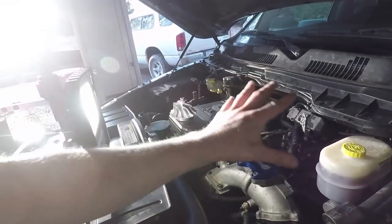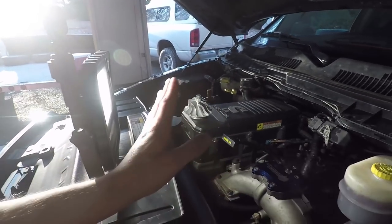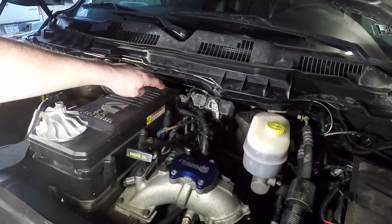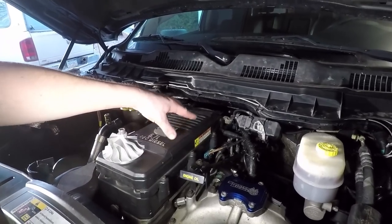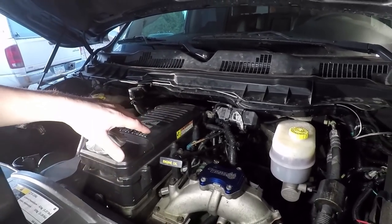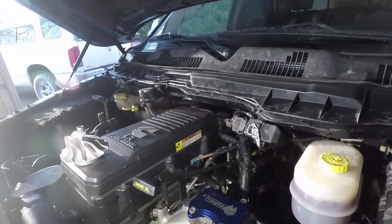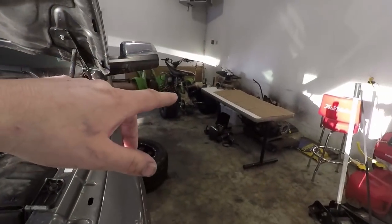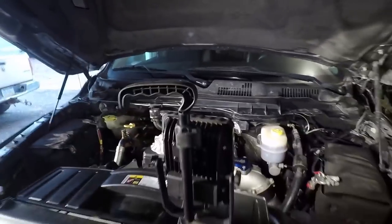We got the oil drain disconnected, the oil feed, the coolant pipe, got the center section of turbo out, all the intake stuff. So tonight we're going to start off with taking off that turbo exhaust housing, then move over here and get the intake manifold off. I like to pull the valve cover off as it makes it easier to get to some of the injection lines. We'll slowly work our way down to the head bolts. We'll be pulling the injectors tonight, the top radiator hose, the fuel rail — all that. I got the table set up with cardboard, ready to hit the ground running. Let's get started.